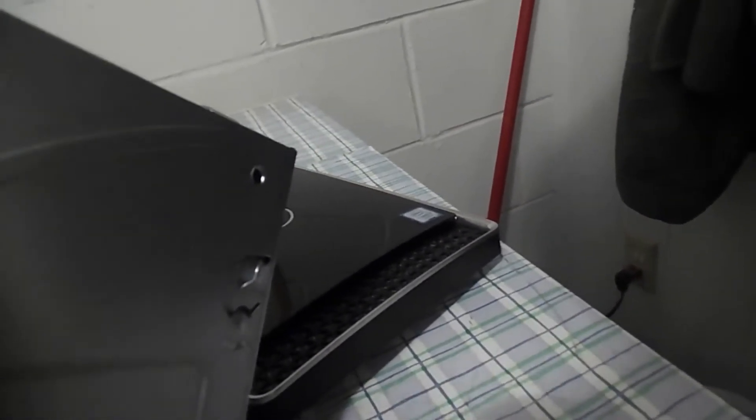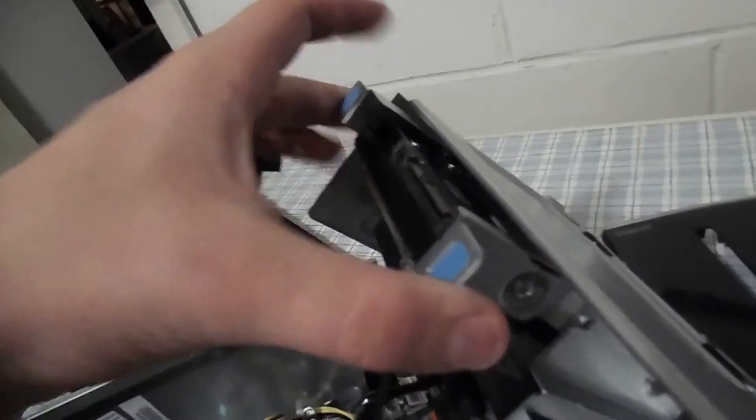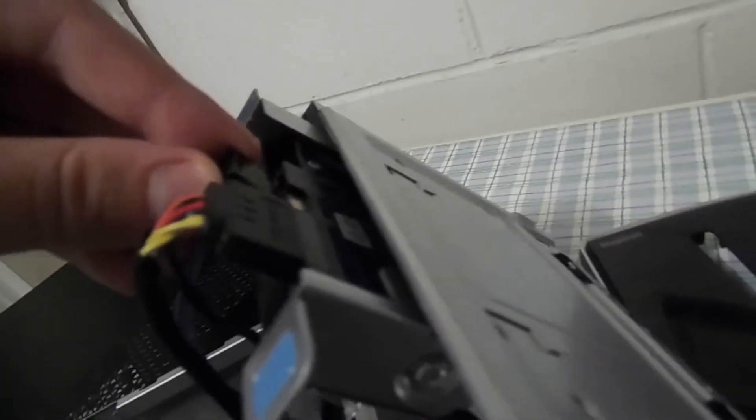Sorry, I couldn't really record that. As you can see, this will pop through at the bottom. Before you attach your cables, place the screw in and tighten it. You're not going to tighten it all the way yet — just tighten it with your finger until it's all the way down. The hard drive is secure now. Put in the power cable first, then put in the SATA cable. As you can see, they're both in.